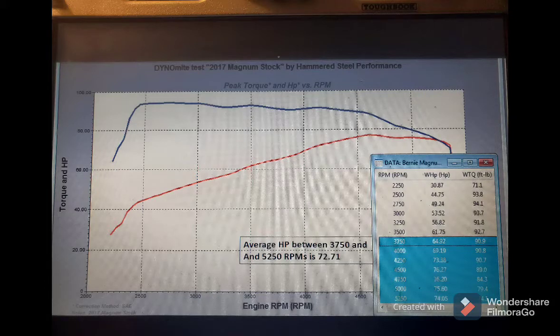Just to reiterate, we're really talking about wide open throttle here. Partial throttle is another animal with a lot of other factors. Also important to consider: between every gear change you'll have a different RPM drop because gear ratios get closer as you go higher. You may have a 1,500 RPM drop between first and second, only 800 between second and third, and maybe 600 between third and fourth. Each shift point needs to be managed individually.